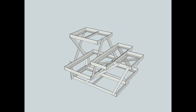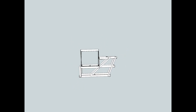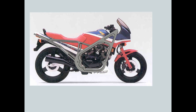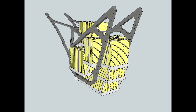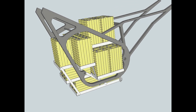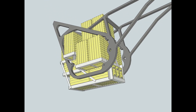Here's the battery tray or battery frame that I've got in SketchUp. I'm not quite sure this is totally it. I mocked this one up leaving some spaces for nuts and bolts, but I think I may end up having to weld it because it may be too tight. Here's a picture of the bike to scale, and an extrusion of the internal frame, hopefully to scale. Here's the battery tray inside the motorcycle frame — it's really tight in a couple of places. One thing not on here is the brake pedal, which may actually be in the way. Welding the frame would make it just that much smaller, which would help everything fit.